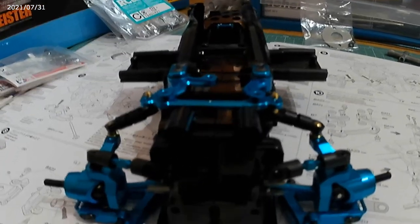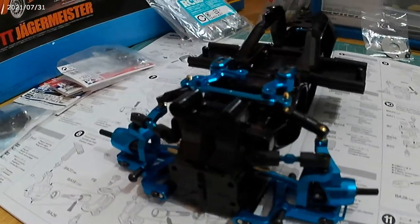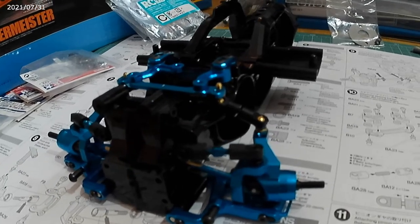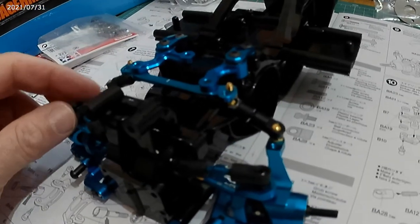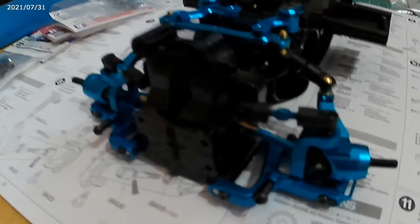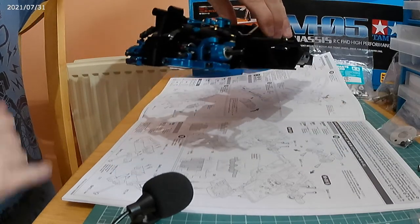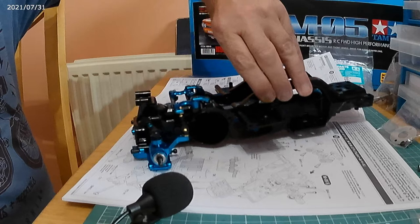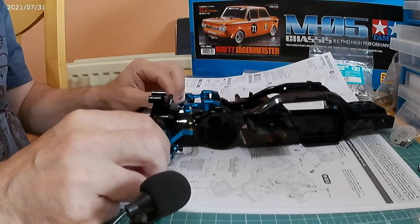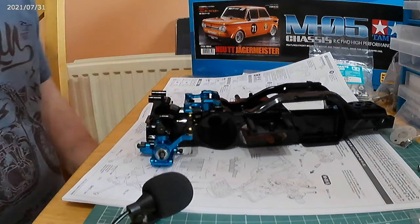At stage ten in the manual there's going to be tons of stuff left over when I eventually sell this kit — it won't be complete, but there'll be loads included. Stage eleven is putting the motor in; I might skip that for now as the next step may be rear suspension. What a piece of engineering — you wouldn't want to damage this. What I've done since is change the top camber links to a higher standpoint, which has levelled things out a bit and generates toe-out in turns, but the track control arms still need adjusting.